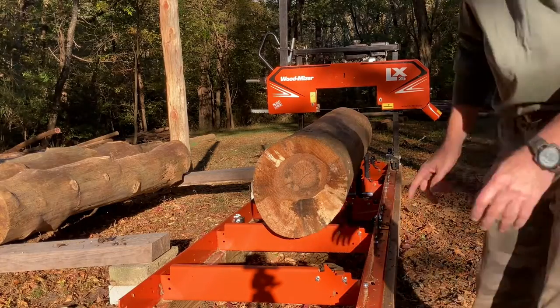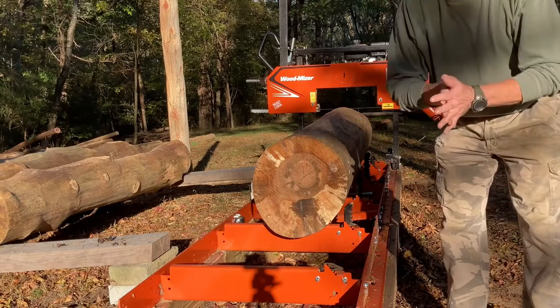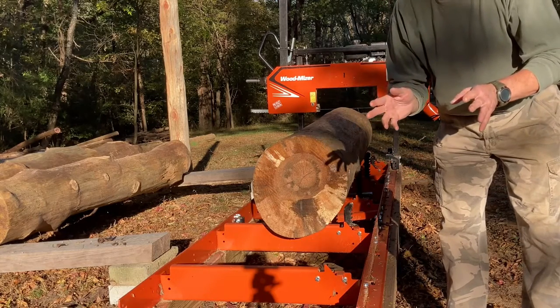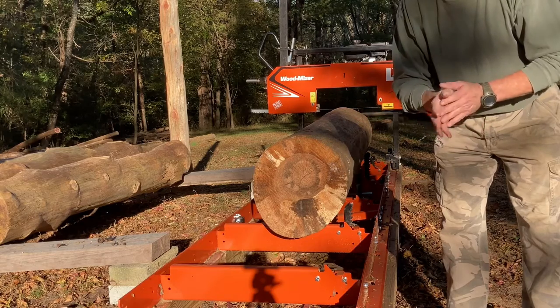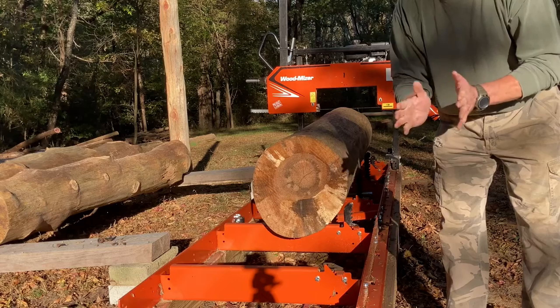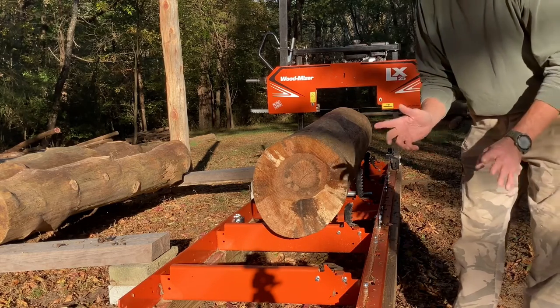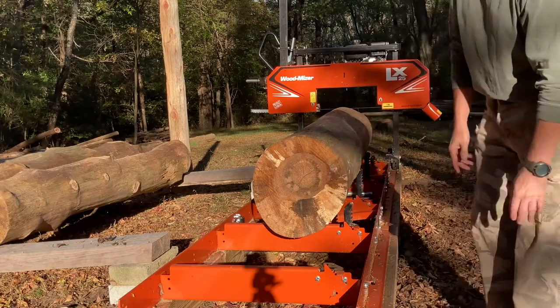this video. I went ahead and cranked it up. But when you crank them up, a lot of times they ain't running a while. I hadn't run it in about a week. You have to let them warm up a little bit, choke it a time or two, but let them warm up before you put it in gear, because sometimes it'll cut off. If you get it warmed up, they run good. This is a 9.5 horsepower Kohler engine on this unit.